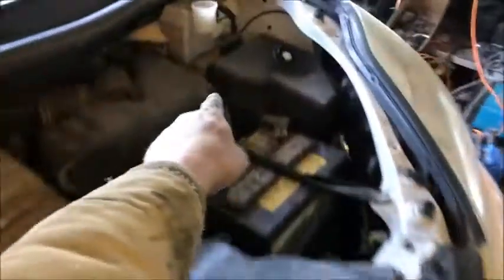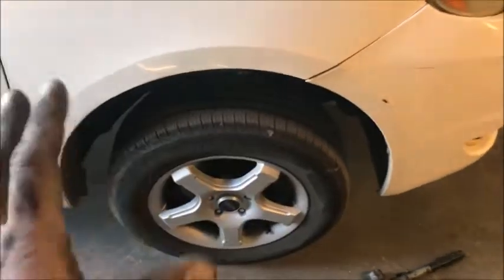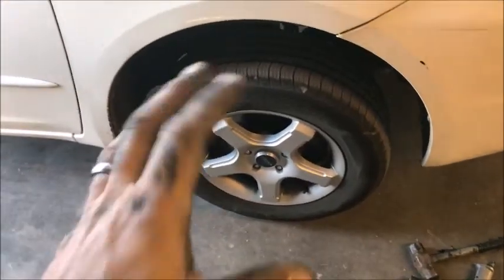First thing I did is I removed the cap on the filler tube, on the brake tube. I'm sorry, reservoir. So I took the cap off the reservoir. That's so that we don't have to bleed the brakes. I'll explain that to you more at the end of the video. This video is only going to be a few minutes long. We'll make it quick. These are simple.